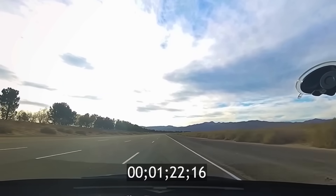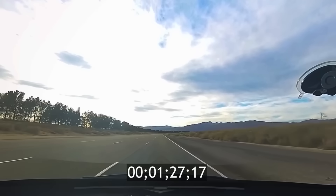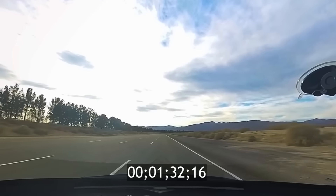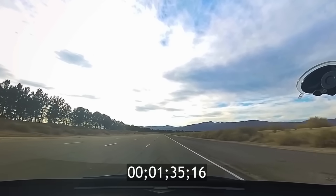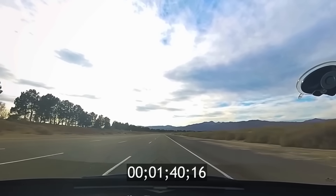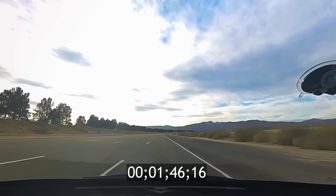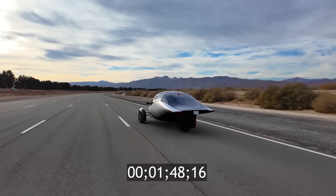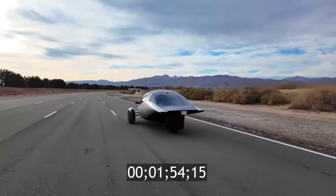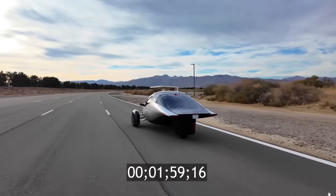The less of those resistances the vehicle has, the longer it takes to slow down and come to a stop. They showed this vehicle and if you watch the whole video, they tell you the speed at certain time points throughout, and it takes about three minutes to reach the end. I tried to find a spreadsheet where you could input the numbers and get a coefficient of drag out of it — I couldn't find one, so I had to make one. I'll put a link in the description to the Google Sheets spreadsheet so you guys can play around with it.